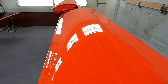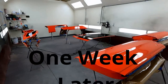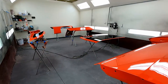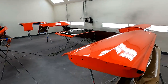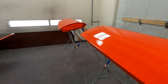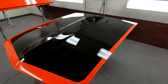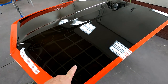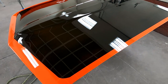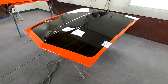Okay, I'm gonna spray the next coat. Okay, last coat on. So I put three coats, then I wet sanded it with 800 grit, and then I just put three more coats on. And so I'll cut and buff this. And these parts will all be done, except for the hood, of course. I'm going to sand all the black, tape this off again, and then spray my black, my semi-gloss black. And then there's a pinstripe that goes down along there as well.